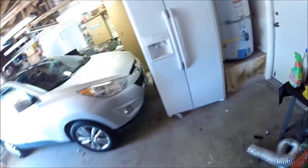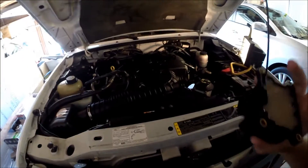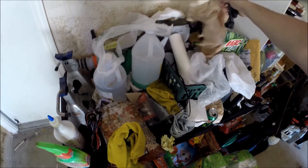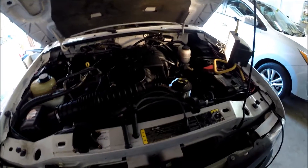All original, never been taken off or serviced. I went on to Rock Auto — I love that site — and picked up what I believe is a Spectrum Ford Ranger ignition coil; feels really high quality. Then I went ahead and bought the Bosch spark plug wire kit, a full set. Everything looks just like OEM. Surprisingly, Motorcraft did not offer the spark plug wires, but they did offer the coil pack for like 70 bucks. This and the wires together with two-day shipping was $49, so that's why I love Rock Auto.